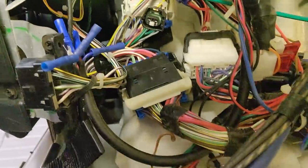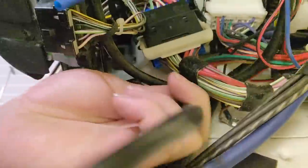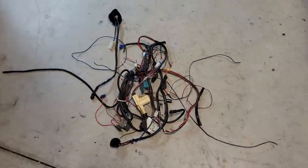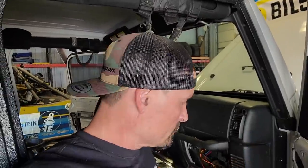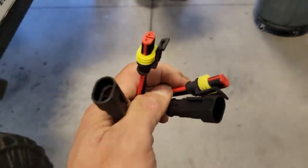We're just going to start fresh and do it right. All this wiring, the whole box thing — it's a mess. All the box, all the extra stuff — all gone. It still starts so that's a good thing. I'm just going to put in a couple of wires so the windows go up and down. I'm going to put a connector on the end of the motor wires, tuck it underneath, put a nice sleeve on it so there's no extra wires. Just two wires, so you have to unplug them when you take the doors off. Just simple weather packs. That's it.